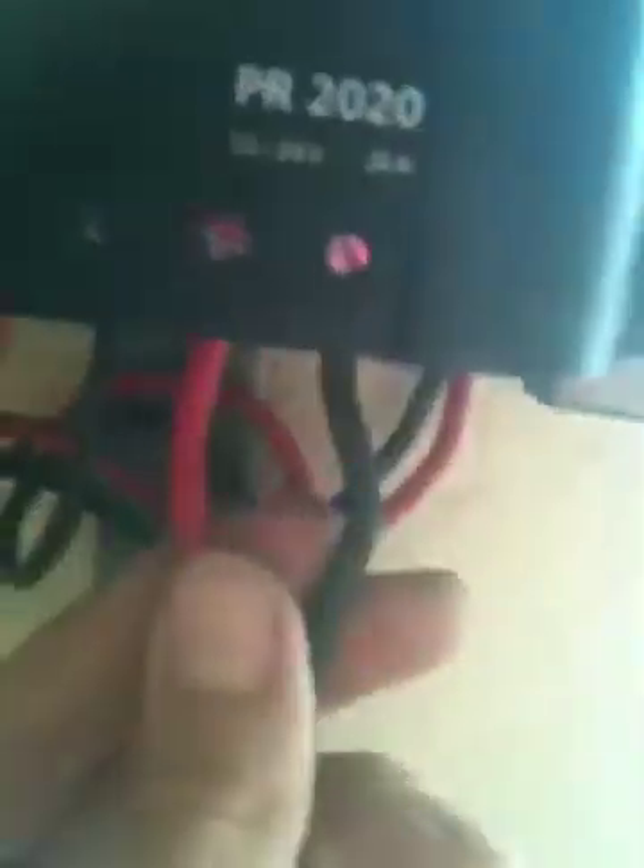This is not a long-term solution. This is not big enough right here to run the inverter, because the power starts down here at the battery. This cable from the battery goes up and in right there and out. So if you plugged a TV in, this thing will actually give you an error message.